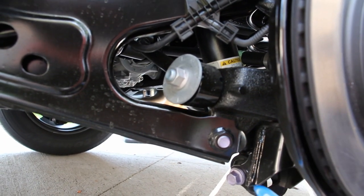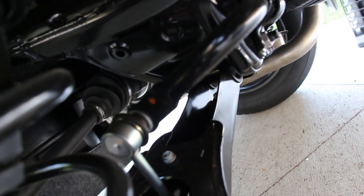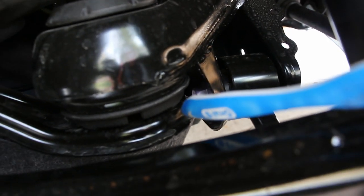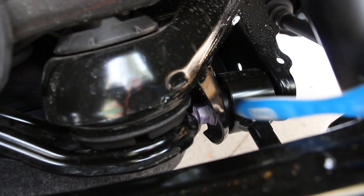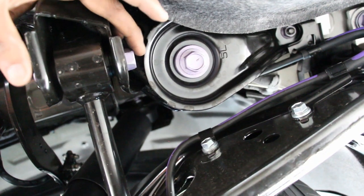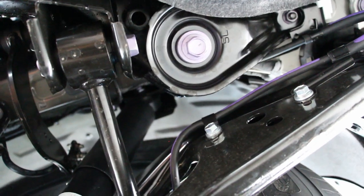Toyota has made some interesting changes to the typical multi-link setup. Replacing the shock absorber is pretty straightforward — you've got a bolt to the top there and a bolt at the bottom. Inside of the lower control arm is this little stabilizer link that connects to the sway bar that goes over to the other side. The coil spring is also pretty easy to replace once you remove the bolt at the bottom. However, I think Toyota could have done better with the placement of some fasteners. Here's your front upper control arm, and you've got the bolt located over there right up against the subframe bushing. The manual actually calls for you to remove the entire rear subframe in order to take this arm out, because this bolt has to come out this way but it's going to clash into the subframe. On the opposite side you've got the nut — they should have put the bolt on this side since it's much easier to access.